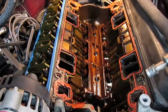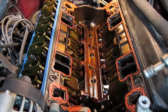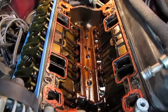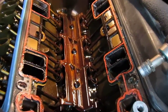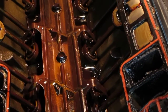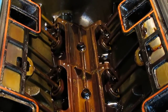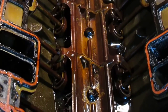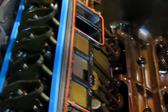This engine is in pretty good shape for 200,000 miles. It uses no oil — I change the oil every 3,000 miles using Pennzoil 10W30 — and I see just a little bit of sludge down around the lifters, but not very much at all. This engine does have a roller cam in it from the factory. You can see that spider, as they call it, that keeps all the roller lifters straight in line, and it also has the guided rockers on it, which came out with the Vortec engine.